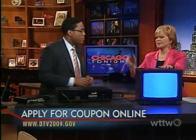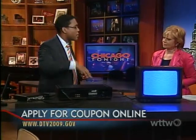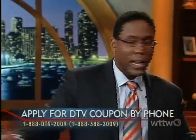You can still do this hookup with the VCR. The only big downside is that timed recordings are going to be kind of tough. So I can't watch this and record another show at the same time? Not with the setup we have right now — whatever this tuner is switched on, you're going to have to watch that and record that as well. If you add another tuner into the mix, then you can watch and record different things, but now you've got tons of connections.